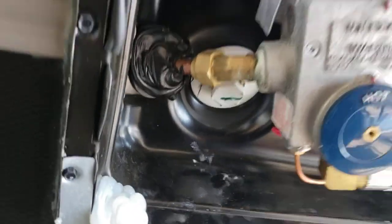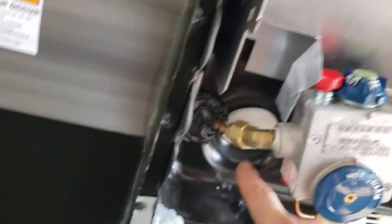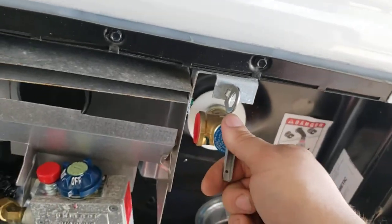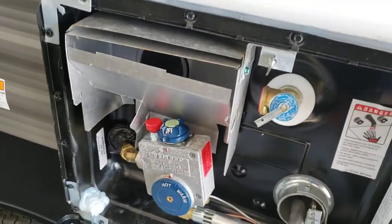Before you pull the drain plug out, open up your pressure relief valve — water will squirt out, that's fine. Once it stops, snap it closed, then pull the plug out. If you neglect to do this first, all that pressure won't release here and you're going to get a bath. If you've been running it, it'll be a hot bath — that's no fun at all.